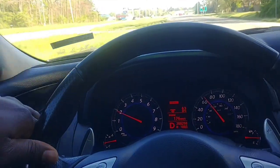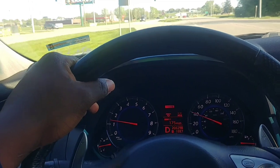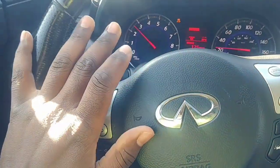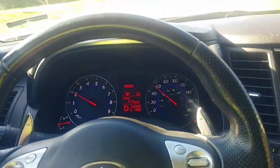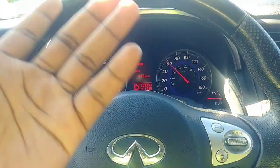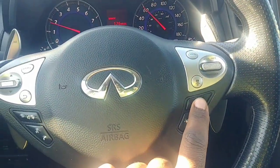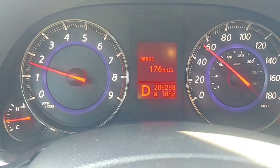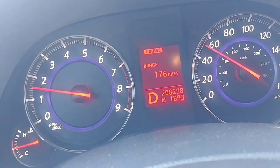The question is how to make it operate in standard cruise mode, because sometimes intelligent cruise gets annoying — depending on the driver in front, the system can get a little erratic and start sensing ghost things, especially around bends. To switch to standard cruise, just hold the button down for about one and a half seconds during startup. You'll see the intelligent cruise indicators disappear, and it cruises normally. Hold it again to toggle back.